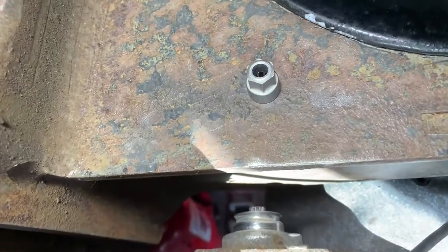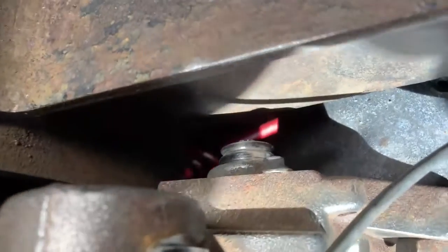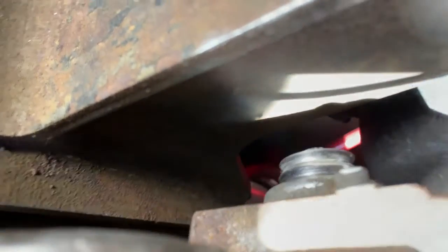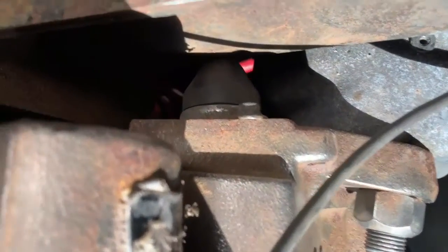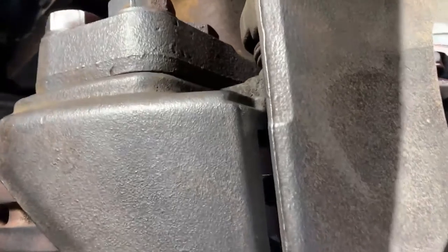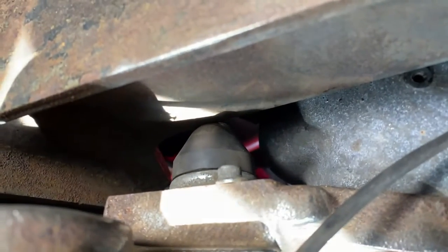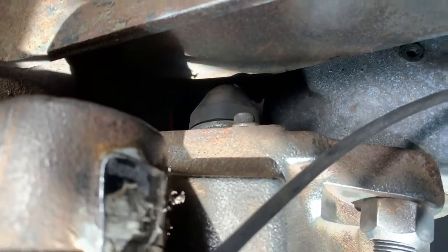As a solution, I'm going to leave the adjuster out for now and put the rubber cap back on, but the rubber cap still hits. When I take the brake caliper off, I'm going to machine just a small piece out of the bottom of that rail — not enough to cause any serious structural or stress issues, but enough so it doesn't hit and damage the caliper. Here's the rubber cap reinstalled. You can see it's depressing the cap, but we still have considerably more movement on this caliper than before. It's not totally free and not good until I remedy that foul condition, so advisably get your mechanic to take a look and clear that foul condition.